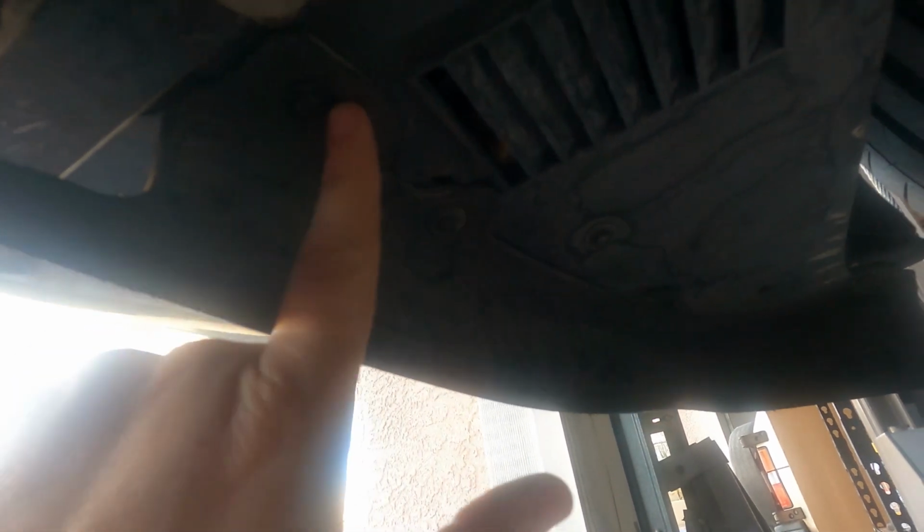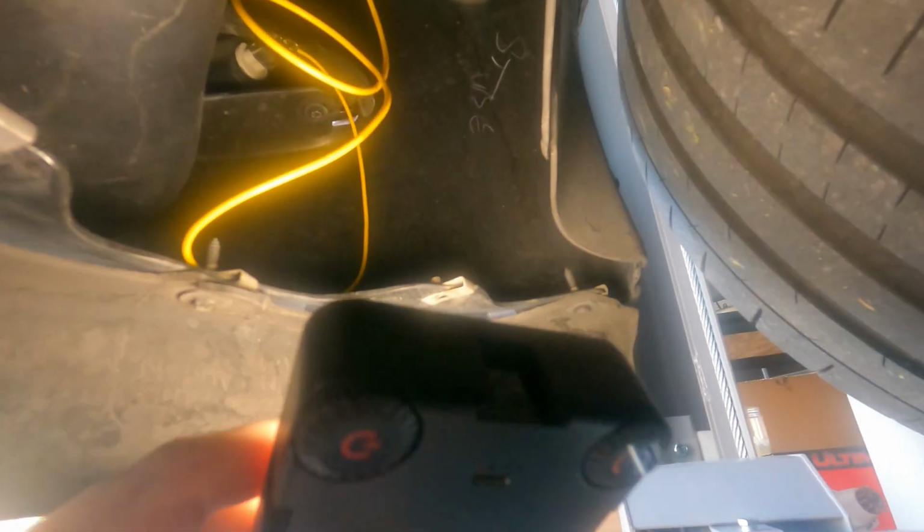This is your access panel right here. Now you don't have to take this lip off. I think this is the only screw. It's the edge one that's common to this panel. I think the others are just solely in the bumper. So you're just going to want to get this off. A couple in the back side here, one here, one here. Don't mind the extra long wire. I was using this for testing. Those will be shorter, but obviously you can see that's just tapped into that side marker light. This is what runs the halos on the headlight kits. So obviously I have a lot extra wire there, but it's a real simple tap into that.